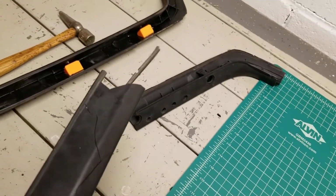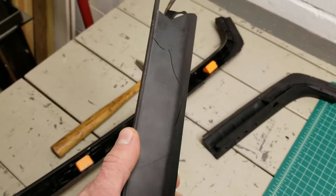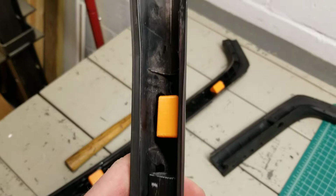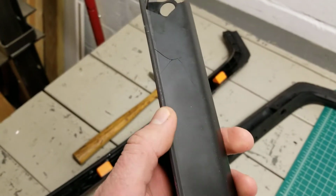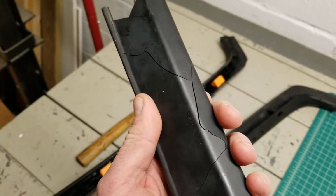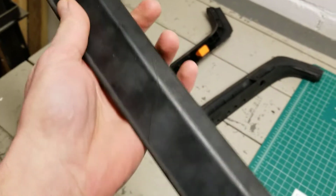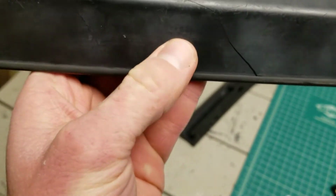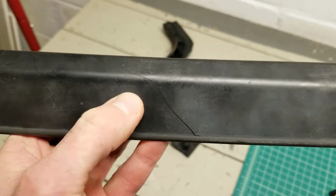So I've done all kinds of different testing on it. But this one I hit hard enough that it cracked the plastic on the back as I was testing the glue. What's interesting is that no matter where I hit this thing, it always broke in a different spot than the glue, and it actually breaks around it. You can see the tab is right here. This glue is strong enough that it's holding the C-pillar trim together behind there. And I hit this thing really, really hard, just trying to make sure that these tabs were never coming out of there. There's another one I glued in right here, and you can see where it broke around that.